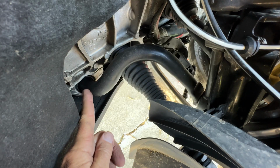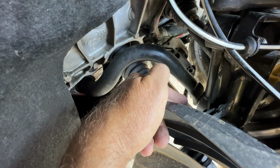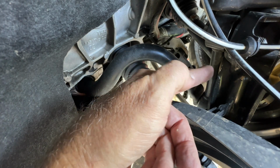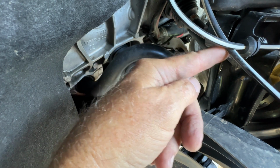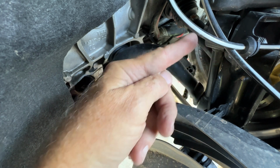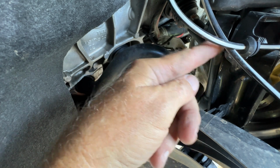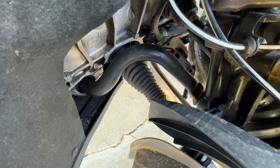So here is the stabilizer bar. The bushing is here, it loops around here, and that's the end of it. And then this link bolts through this bolt to the bottom of the damper and air spring assembly. So they all join up right here, so they'll all have a common motion ratio.